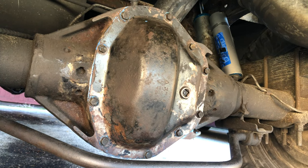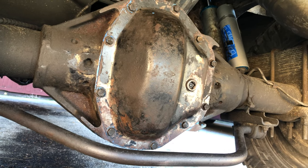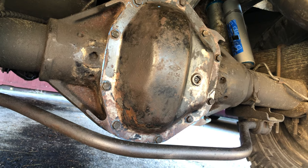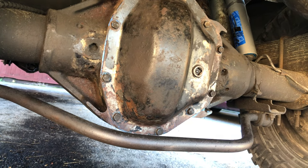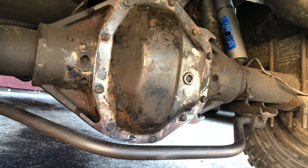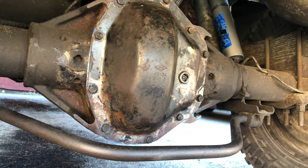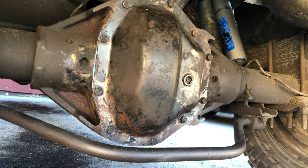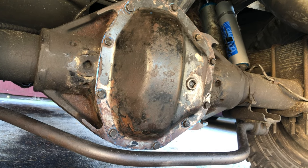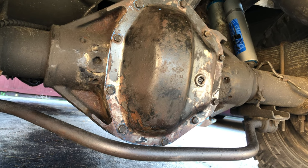In the Yukon instructions they recommended not using flame when heating up the ring gear to get it on the carrier. In my case I had a heat gun and a 250-watt work light. I set the ring gear on top of my vise with the two heat sources close to it, left it like that, rotated it often, and when it felt hot I put it on the carrier and tapped it down with a soft-face mallet.